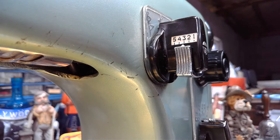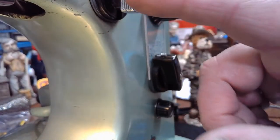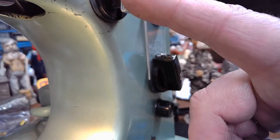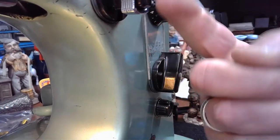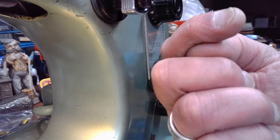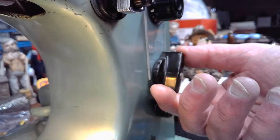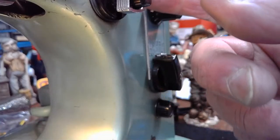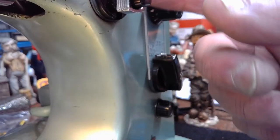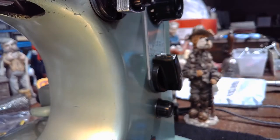What we're going to do now is we're going to recalibrate. Whenever you're changing this slider and you're going to another stitch pattern selection, you recalibrate that stitch width down to 0, which retracts that finger from the cam. And then we're just going to slide this into position 4 now, like that. And then we remember to bring our stitch width back to 4. And we're all set to sew that last decorative ornamental pattern that is on the revised cam B that's in the back of the machine.